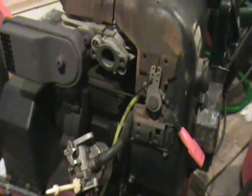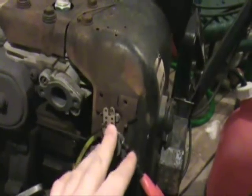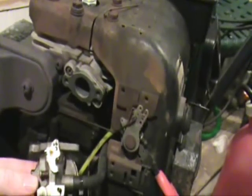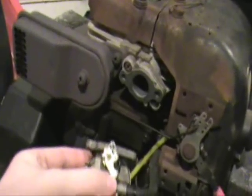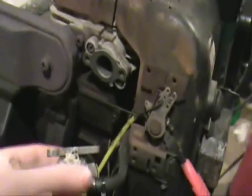Okay Dad, so in the next stage of disassembly here, I wanted to separate the carburetor from the machine, which used to be connected to the throttle control assembly right here by a hard steel wire. Since I didn't want to bend that wire — because its length is correctly adjusted for this machine — I needed to take this off. I wanted to see that the throttle assembly here moves freely and uninhibited, with no burr or piece of metal causing it to stick. And you can see quite clearly that it moves very freely — it has a very light return spring that forces it closed. So this is not what is causing the sticking.